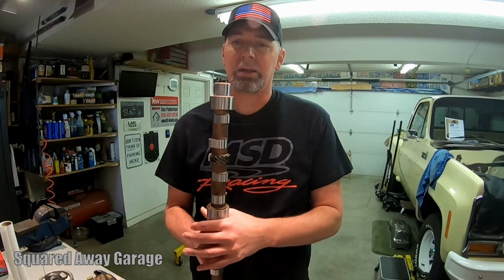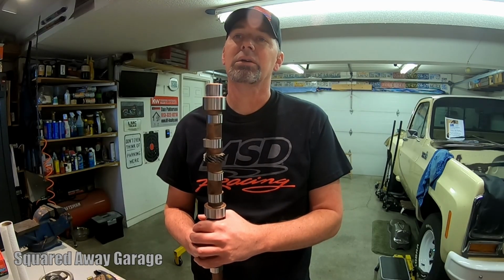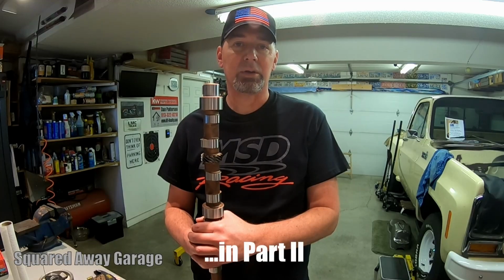So everything's kind of coming together here, and the engine's got to come apart now. The cam's bad, I got to get a different cam. I've talked to this guy about fine tuning with the injector phasing. He's agreed that it's going to make a big difference, but it's not going to get the engine to 100%. So the engine's apart, and I decided, on the thing that I've been the most stubborn about up to this point, to go ahead and divide the intake ports on the engine. So what you're going to see coming up here in the video is some of that process.